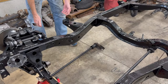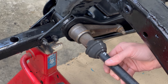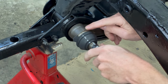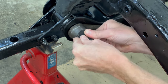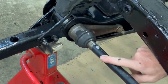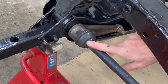The last piece of the puzzle for the front suspension is the torsion bar. You can see the line here that I used to mark to make sure everything gets back in the exact same place it was originally. I did clean this one on the wire wheel so the markers are gone, but I put a little scratch in there to make sure I can get everything back in the right place. Pop this rubber boot back over this lip and we're good — everything's back the way it was. Later on, once the truck is on the ground, I will be adjusting these torsion bars to fine tune the ride height, and I'll show how to rekey them as well.